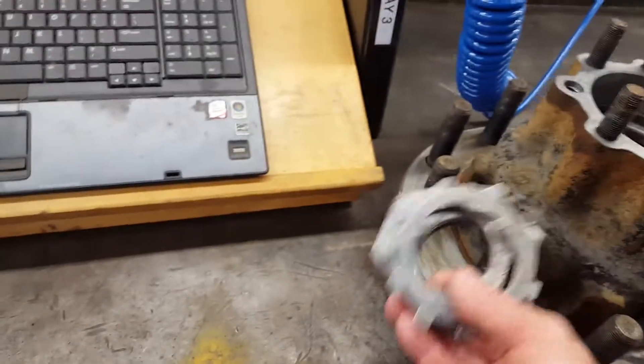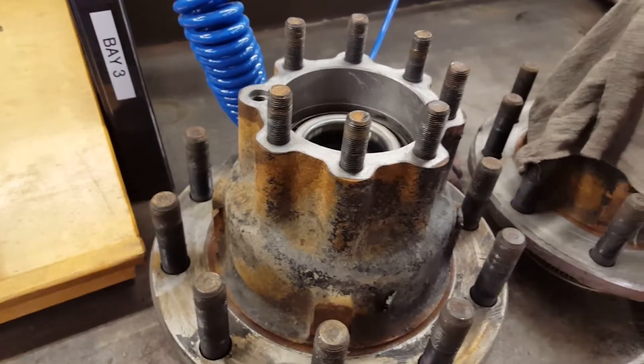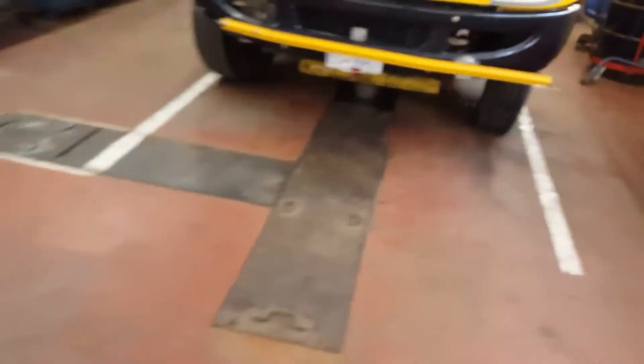These are ABS brakes — all modern school buses have ABS. And that's the tone wheel right here, where the sensor reads and sends a signal to the ABS module. We have traction control for motor driving, and the ABS brakes work really well, so we don't get any spin out.